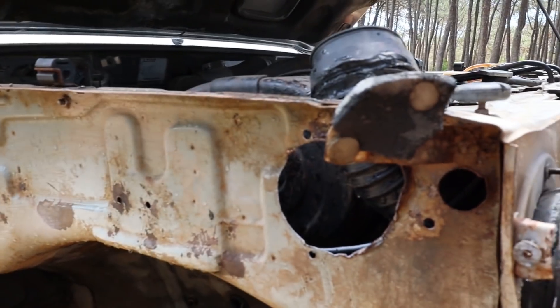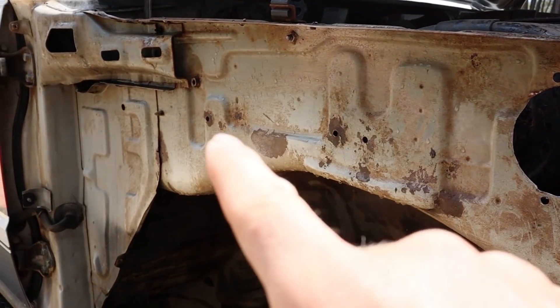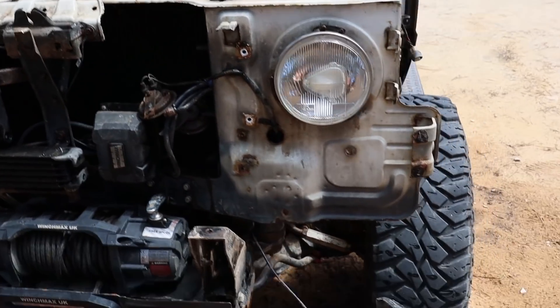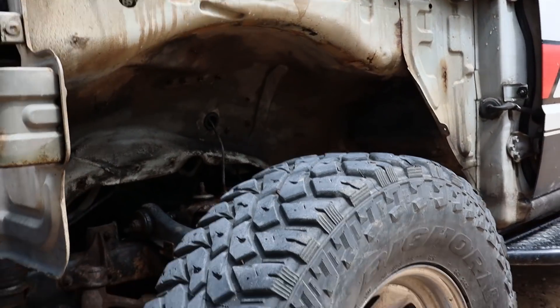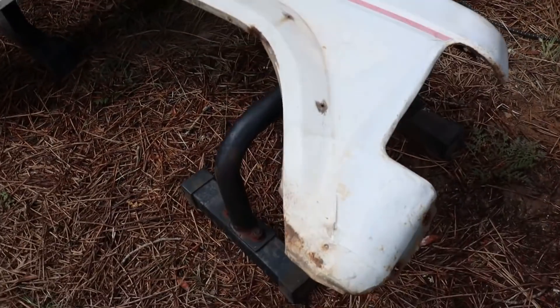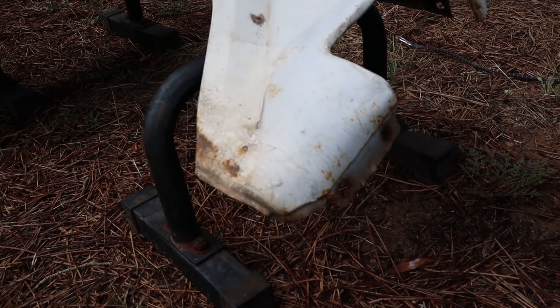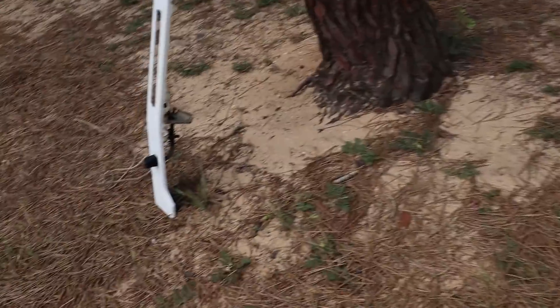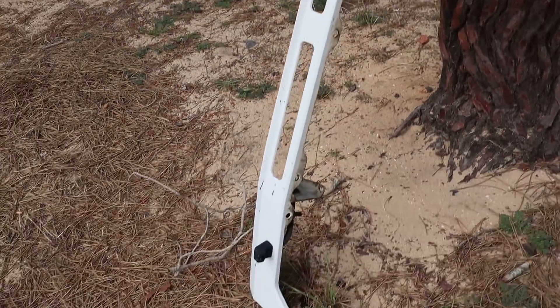I've given it a wash already but it needs all prepping because there are always some slight rust patches forming in and around, and I want to deal with it now while it's still mainly surface rust. I want to get it all protected and coated underneath too, and sort these wings out. This is what I actually did the job for — to sort this mess out on the front corner of the wing — but it's escalated quickly. I've got that one, that one to sort out as well, and the panel that goes on the front. I need to clean up and paint, so I've given it a rinse down and I'm boiling some hot water for a hot soapy wash, then start grinding, sanding and prepping it for paint.